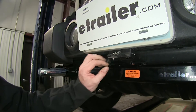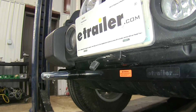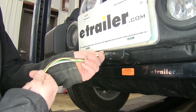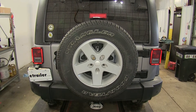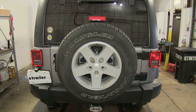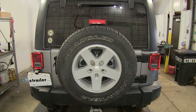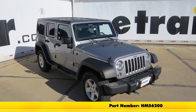One of the last things to do is go ahead and take the cover off and use some of the dielectric grease that comes with the kit to help protect the contacts. With everything hooked up, we'll go ahead and try it out. You'll want to plug this up to your RV and make sure everything works. I'll just go ahead and apply power on my own and demonstrate how it works. First, we'll try out the running light circuit — you can see how the taillights come on. Next, we'll try the right turn signal, and now the left turn signal. A brake signal uses the same signal as the turn signals, so we know that's good since both turn signals work. That wraps up the install for the Hopkins Custom Taillight Wiring Kit for towed vehicles, part number HM56200, on this 2015 Jeep Wrangler Unlimited.